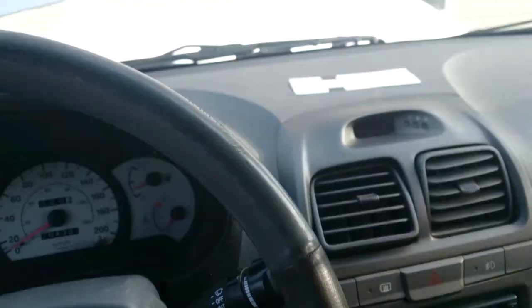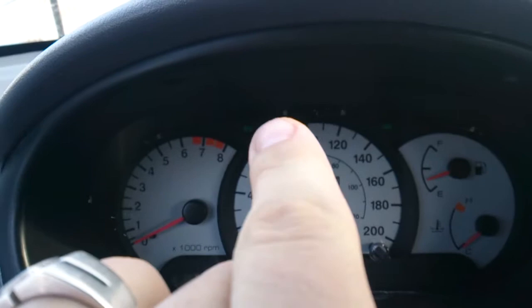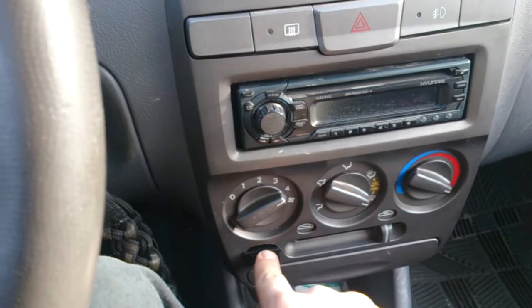Welcome back to PM Gaming 101's garage. I taped off two more LEDs — one over the speedometer, one over the tachometer, and one LED over the gas — and it lights up fine. I got the switch pretty much as set as I can get it; it's running off nothing but the toggle switch. I'd like to get it more flush but there's so much plastic and molding behind there that I had to take the dremel and clean it up. It's fine for now — it's a $400 car, I'm not going to go crazy. Check engine light I've got now is for the purge sensor.